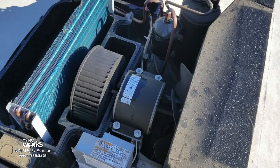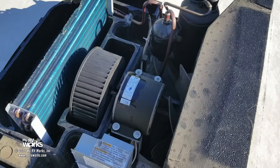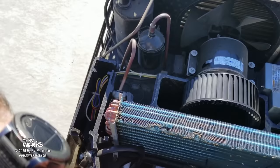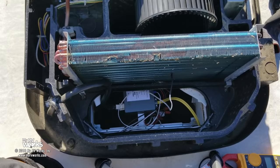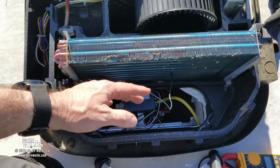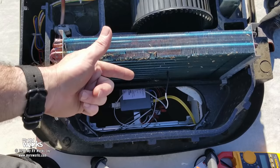I can get to the control board from up here — I just need to go down below and unscrew two screws, and then I can bring the whole control board up here where we can play with it. See that gray thing right down here? That's the control board we're after. I can bring that up here where it's nice and sunny and get some light. Inside of that you're going to have two relays — one relay for the fan motor and one relay for the compressor. If the fan's working but the compressor's not, we might have a bad compressor relay in that control board.